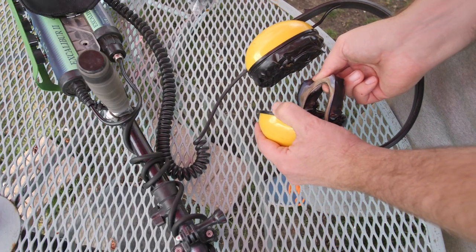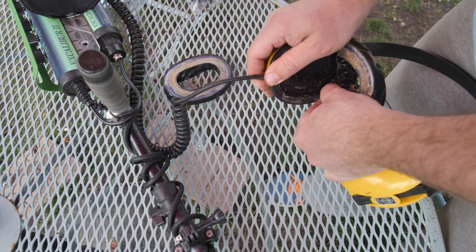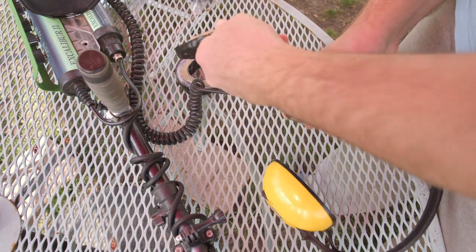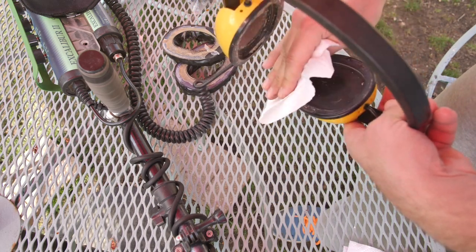We're gonna start removing the old ear pads. You can see a bunch of sand has built up on there, which probably hasn't helped the adhesive that was originally holding them on — hence why they came off. That happened over the course of wearing them, being out in the sun, in the water, the elements. So you're gonna want to go ahead and clean them out to the best of your ability, get all of that sand and grit off of there.